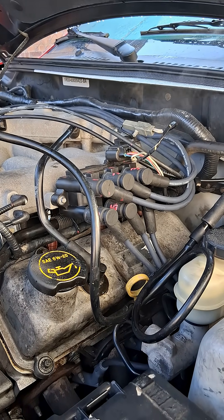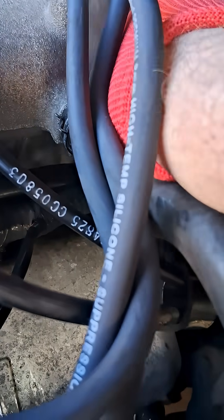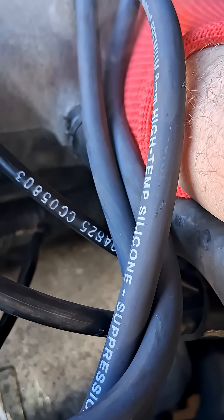And already it's showing. Right there you can identify where you're leaking — saves you a lot of money in diagnosis. Right now I've got a leaking injector base gasket o-ring off the intake manifold on the number six injector.